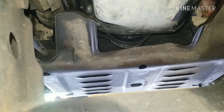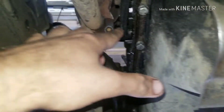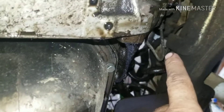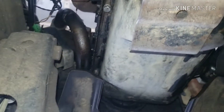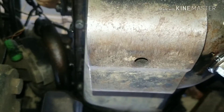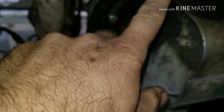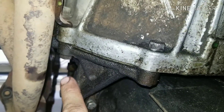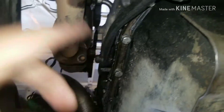Your first steps: go ahead and take off your splash band, then take off these bolts here. We're going to take our pan bolts off and we should be able to drop our pan after we drain our oil. Now with my pan out of the way, I'm going to take these 14s out on the other side. I'm going to take this bracket off — we're going to do the same on both sides and then go after the pan.